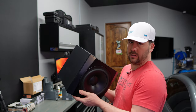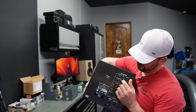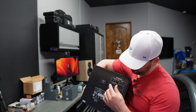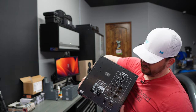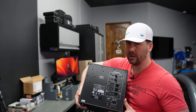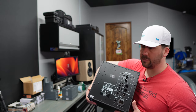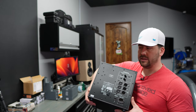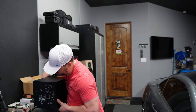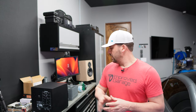On the back side there is no grill because it is a studio speaker. On the back you can see all the settings: on and auto, a phase adjustment, gain adjustments, and a high pass for the satellite speakers. All of the connectors are XLR, which means you need to be using something with balanced inputs and balanced outputs. I'm using a Jotunheim, which is my preamp — it has XLR outputs — and I'll be running that through this and up to my Dynaudio LYD5 speakers. The SVS SB1000 I have right now is really overkill for a desk speaker setup — it can really run away from the LYDs — so I'm excited to see how this works.